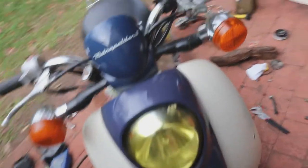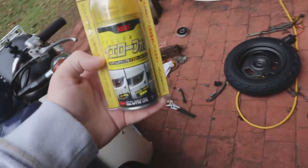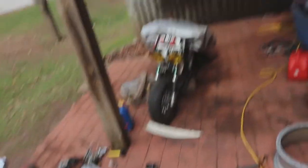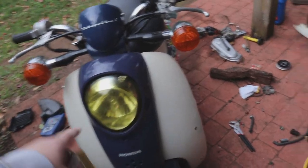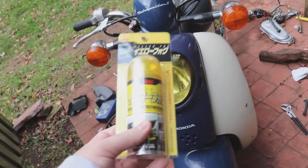Also a little something else that we've been doing — you guys see the bright yellow headlights there. I like the yellow headlight look, it's classic to me. So I used what was left in my last can to kind of start tinting the cover. This is like the OG GDM lens tinter — you'll want to find this, it's not cheap but this stuff is good. I mean you see how dark yellow that is — that was after several passes, almost a whole can on that. I'm gonna take apart this housing again and clean out the bird dookie that happened while I was in the house and get to work.